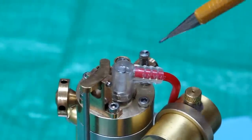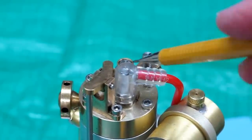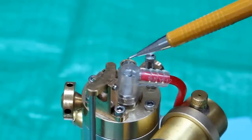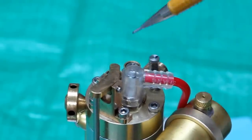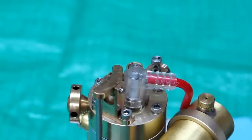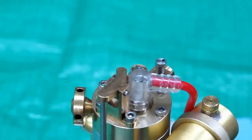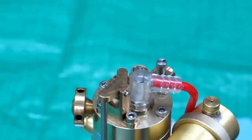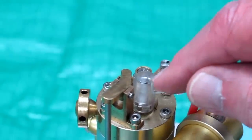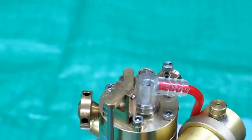The engine was quitting on me occasionally — I wasn't checking the spark plug wire. There's a neat little push-on connector here, but the high-tension lead just pushes in and a piece of bare wire rests against the top of the spark plug. That had vibrated back about an eighth of an inch and it was jumping a small spark, which occasionally caused it to quit. One important warning: do not grab this and pull the wire out while it's running, because if it doesn't find ground for the spark, it will shoot through the insulation and zap you.